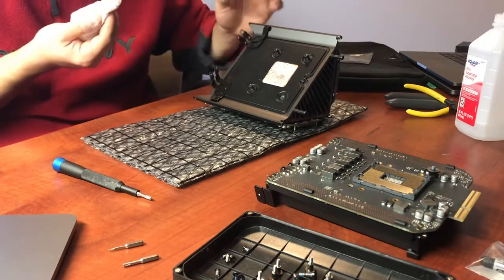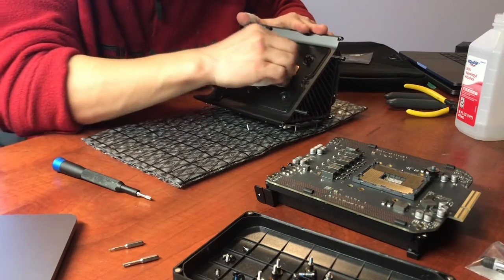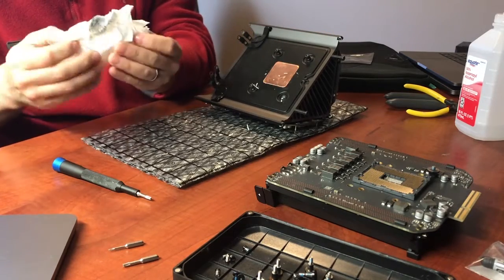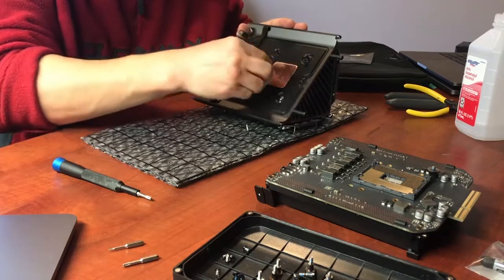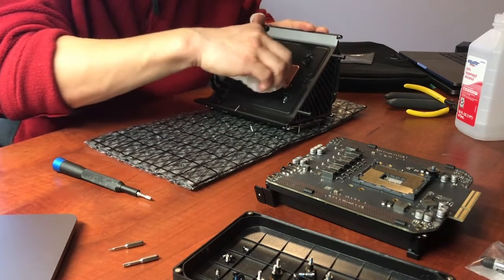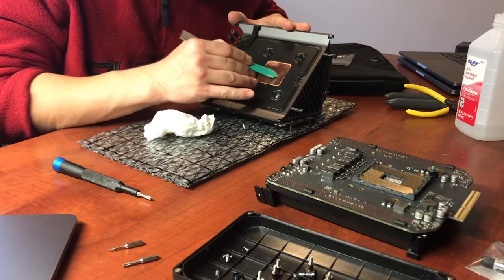There's a spot where the surface of this wasn't flat — I don't know why. I've built all my own computers in the past and it always seems to me like the contact point of the heat sink is normally a pretty smooth surface — no holes, nothing that would store more paste. The surface should be very smooth and evenly leveled so when it contacts the processor, there's a good even surface for the heat to dissipate. Obviously the thermal compound helps. But here I was trying to figure out what that little hole is. I think I eventually just gave up on it.